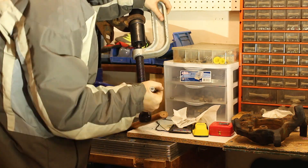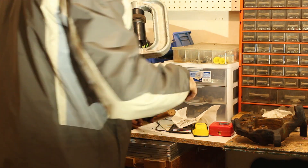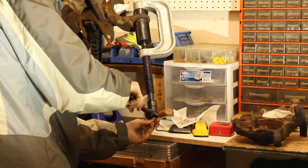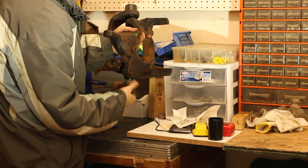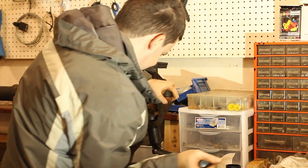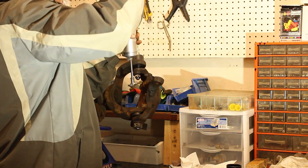We're back on ball joint duty. These splined ball joints fit the worn-out hole properly. I'll also reinstall the knuckle on this side, and I'll post the torque specs in the description below. The other side's knuckle was cracked on this axle, so I'll replace it with the knuckle currently on my Jeep. Don't forget to put new cotter pins, and put the grease fittings on and pump the joints with grease until the boot becomes hard.